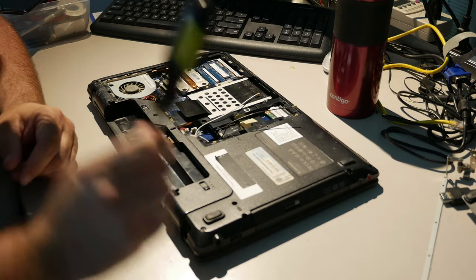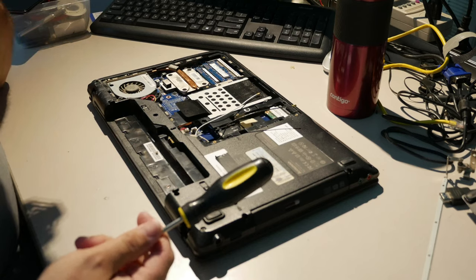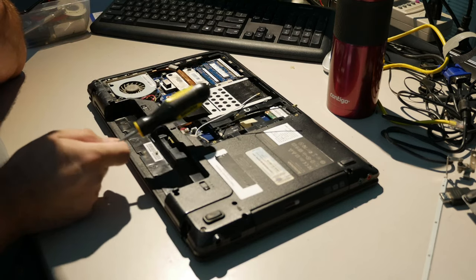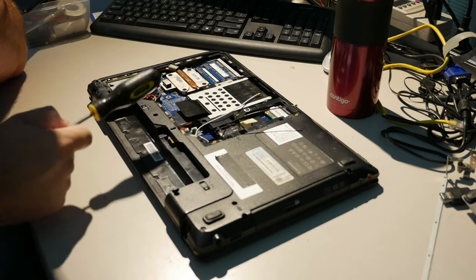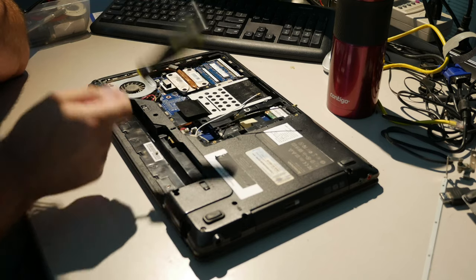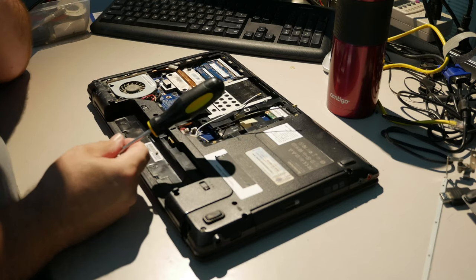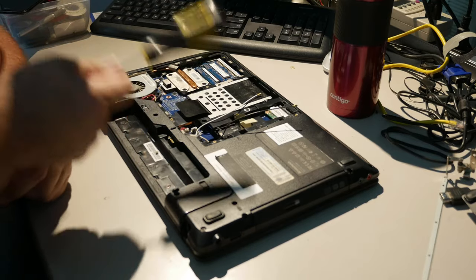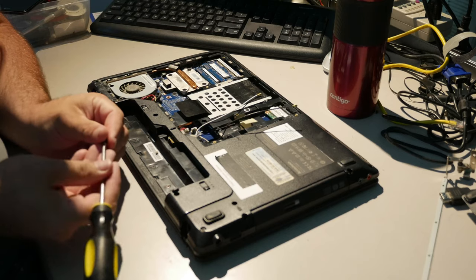Fun aside, if you have a machine where the display gets destroyed, you can pull the wireless antennas out, and you can probably put them, even with just some tape, where the hinges used to be inside the case. And assuming the computer supports an external display as the primary monitor, you can basically just yank the top half off and use it as a desktop. In fact, a lot of computer people do that with busted up laptops if they need a computer in a pinch.